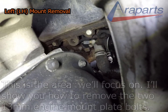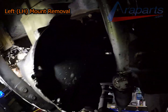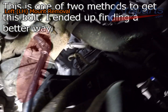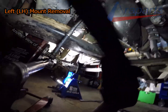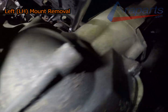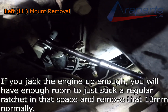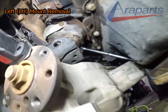Here is how I accessed the hidden bolts from the left-hand engine mount — it's near the differential. You can actually stick your tools up around it and get to it. You can see the location of them right here. This is one way to do it, but I did it a different way that I felt was a little bit easier. Also, you've probably caught a glimpse of my awful oil pan and jacked block-of-wood position here, which I don't recommend. Remember: remove your crossmember and support the oil pan on the larger flat part, not where you see it supported here.